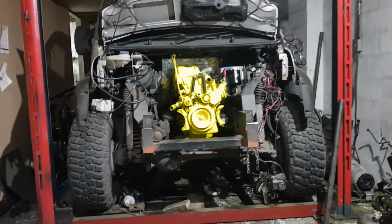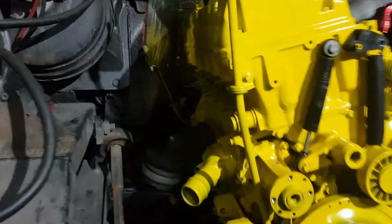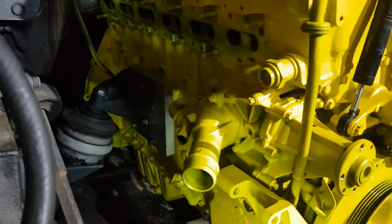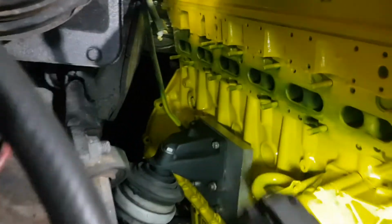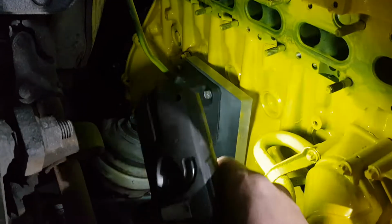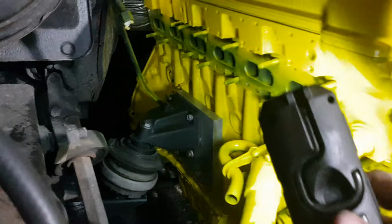The engine is in the chassis permanently, and the good thing is there's plenty of space everywhere around to work on it, so I don't have to remove it to build the exhaust manifold or work on the car around. Plenty of space for the alternator, as you can see, plenty of space for the axle to travel up. I used that thick aluminium plate to move that original mounting up quickly. This is actually the plate I had, as a leftover. I didn't even bother to chop it to size, just left it as it is.